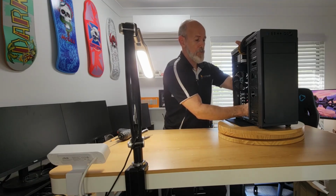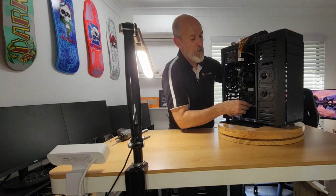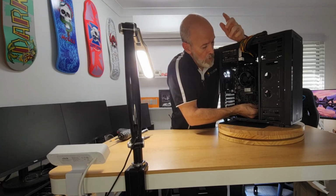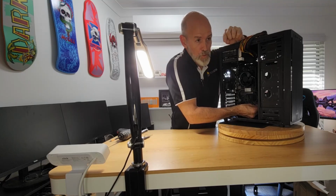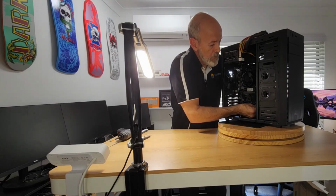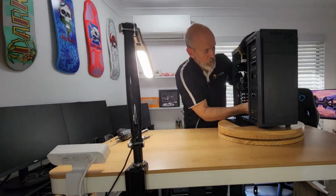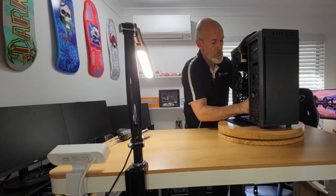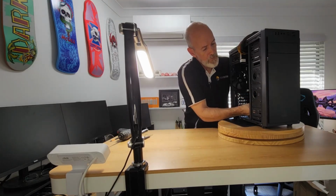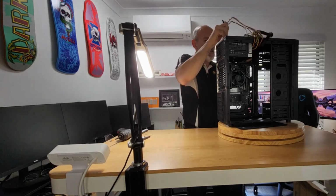Directly under them is your hard drive LEDs. So those ones, the LEDs, you need to get your positive and negative polarity sorted out. Reset and power, as I've said previously, it is just completing a circuit. So the circuit's open, and when you push the button, that connects the circuit via this little header, so it doesn't matter which way around it is, because it's just there to close that circuit. It's much like a micro switch in an arcade machine for your pew pew button. All right, so they're in there and they're already sorted, so let's move these other things.